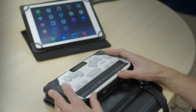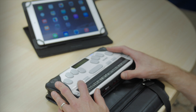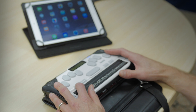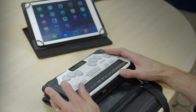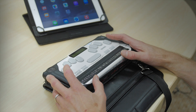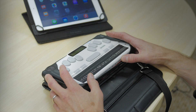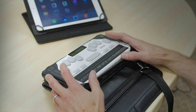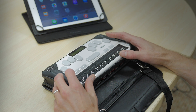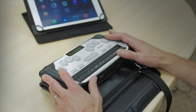The first thing we're going to do is press function key 1 on the BrailleSense, which will take me to the BrailleSense start menu. I'm at the file manager. The first part of this pairing is going to be done from the BrailleSense side. The BrailleSense will automatically turn Bluetooth on if you don't have Bluetooth on when you go into the terminal for screen readers, so you don't have to do anything as far as those settings go.